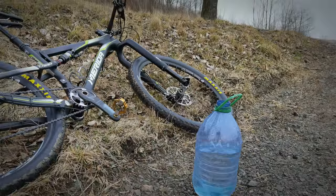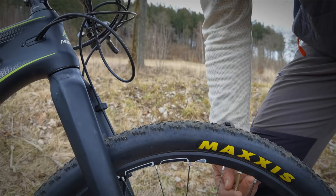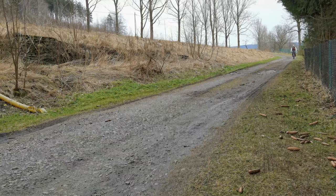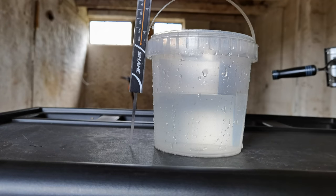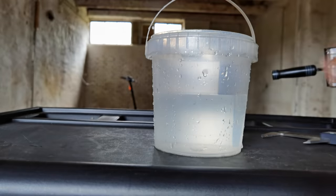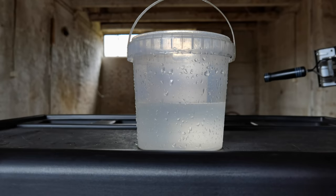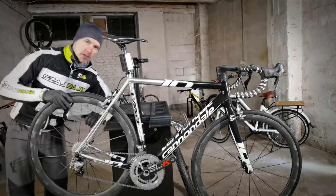Let's take my bike, some water, and a pail to check on a gravel road how much water stays in it with the correct tire pressure versus a high tire pressure. I fill it and ride down the hill with the suspension locked. We check with a caliper how much water is left — about 63 millimeters. Then the same slope at 2.5 bars: higher pressure meant a harsher ride and more water spilled. This shows that lower pressure gives better traction and grip.